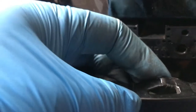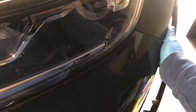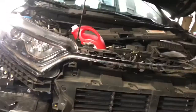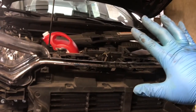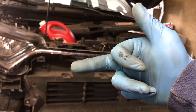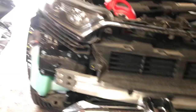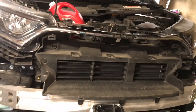Like I did right here — one of them broke — so you just want to pull it out slowly and work your way around. To recap: that cover on top, you actually didn't have to take it out, so good thing to know. I went ahead and took off the bumper as you can see. Basically everything I showed you to take off, besides the top cover, you do have to do — all those clips on the bottom.